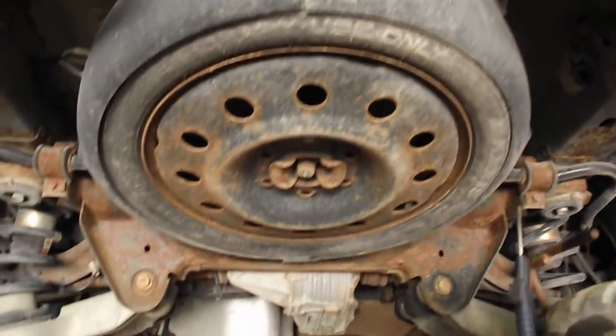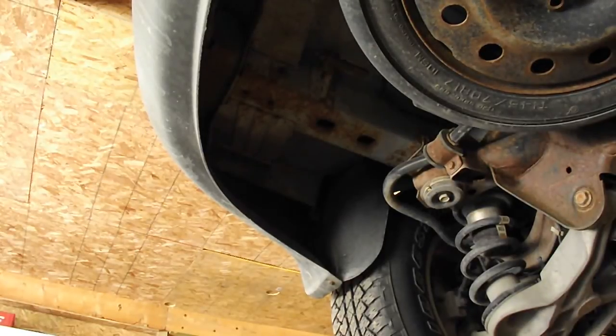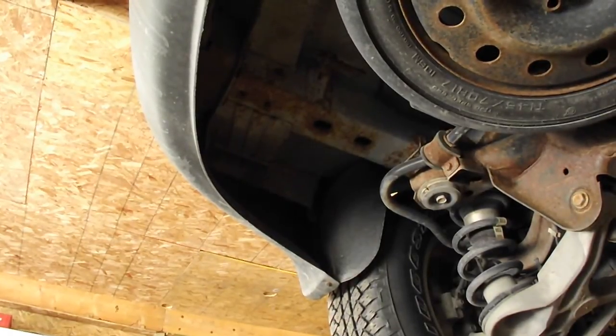This is a high-mileage car — it's got over a hundred thousand miles on it. The directions for the installation tell you to just install the bolts into these existing holes, but I can't see putting a bolt in there without cross-threading it and getting it stuck. So what I've done is I've got a tap and I went through and cleaned out the holes. The other two mounting locations on the other side are right here. They don't have welded nuts up there, they're just hollow holes. The kit came with a bunch of hardware.